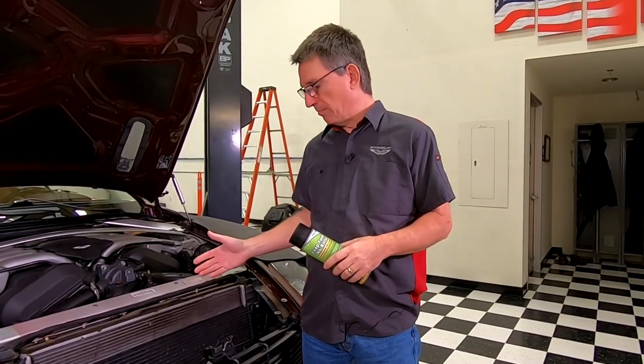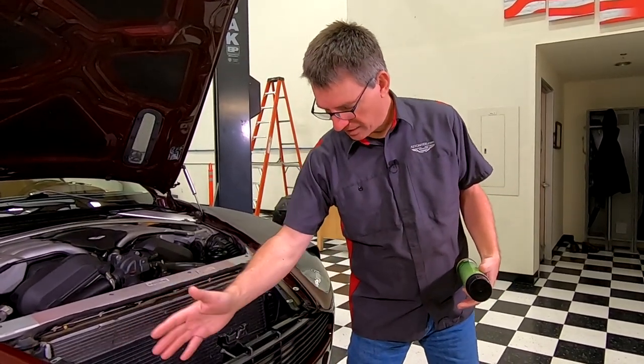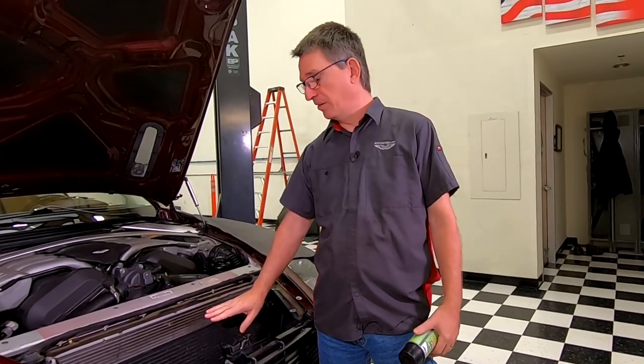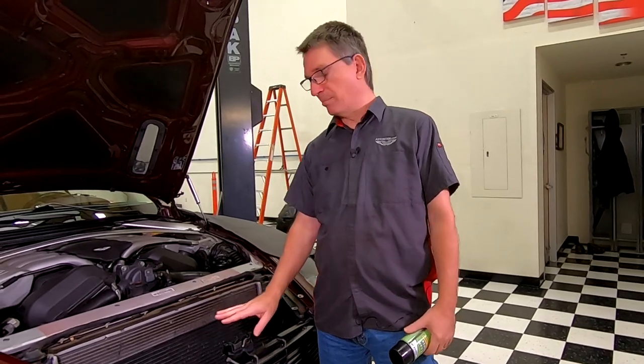If that helps keep the car in tip-top shape, I'm pretty happy. This is also a mileage-based thing. My car is 16 years old, but you only collect bugs based on miles driven. The bugs fly through the grill and die on a 200-degree radiator grill, so they bake on. As you collect the miles and collect the bugs, it's a good reason to get in here and clean this once in a while — maybe every five to seven years when you're doing your engine coolant swap.